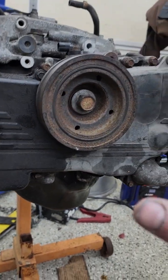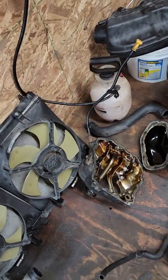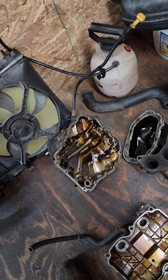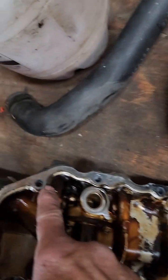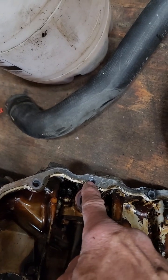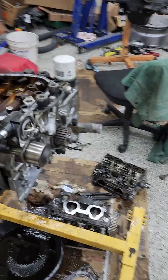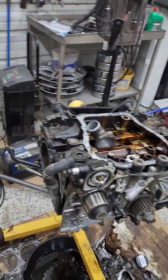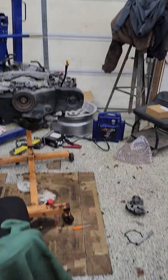That's the major difference. You also have to remove the pickup tube and splash shield from your old motor and install it into the new one, because the 2011 motor has a two-piece oil pan — it's completely different. Most of the bolt holes line up, but a couple were slightly off from the 2009 and back motor. The old oil pan will not sit down in that vehicle; it's made and shaped differently, so you can't make it work.